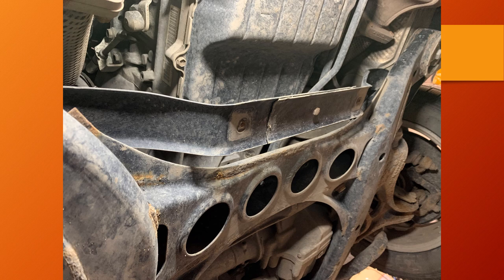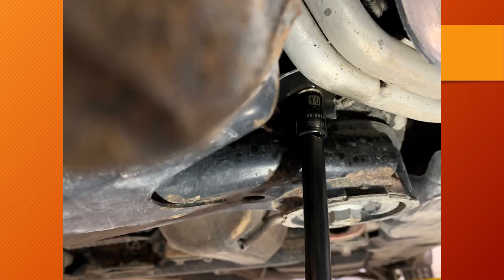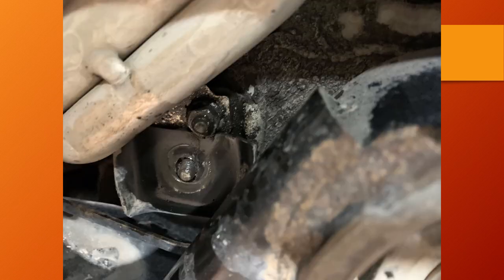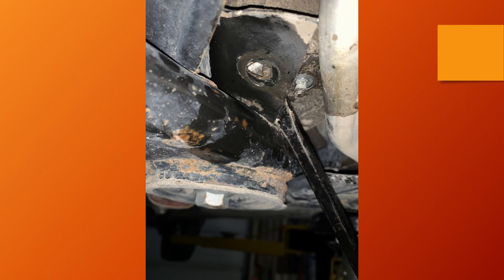With the car lifted and the belly pans off, you can see what's called the transverse strut running across the car. Its function essentially is to provide attachment points for the under trays to be screwed to, so we need to remove that. Removing the transverse strut involves removing one nut on each end, plus a bolt in the middle. In my case this nut was preventing the bracket from coming out, so I had to remove it using a small pry bar to gently get it over the stud.